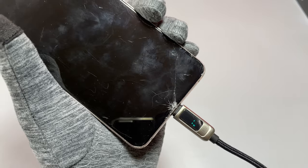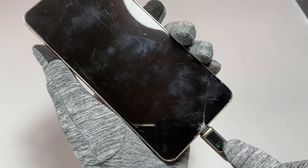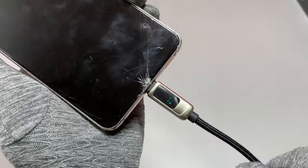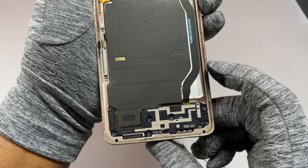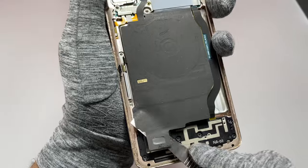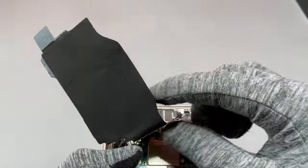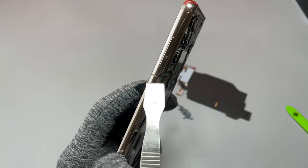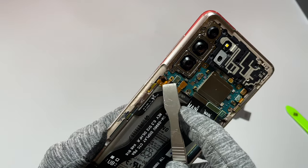The back of the device has been removed. The device is not charging, the screen is not responding — it's basically a dead device. As you can see, we have one watt going through the device right now. This is not normal; the device should be charging at more than one watt. The only scenario where it charges at one watt is if the battery is full, and I doubt that's the case. I've removed all the screws to dig deeper.